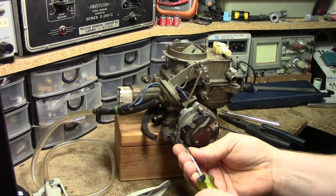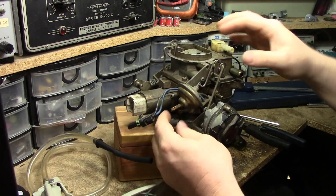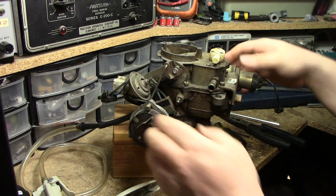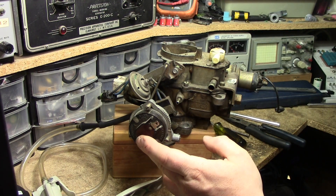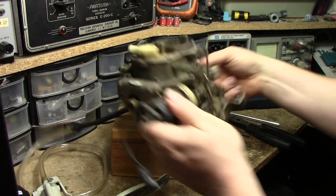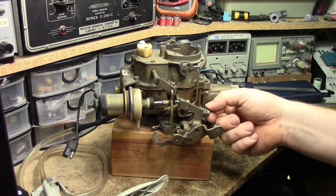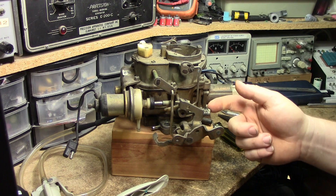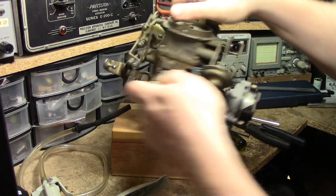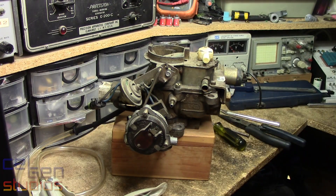And there we go. So at this point, when you start the vehicle up cold, it'll do the initial pull-off and will have it set to the correct enrichment and lean-out point. As this begins to warm up, it immediately begins opening the plate until eventually it just completely unloads on this side. There is another adjustment for this linkage, and obviously an adjustment for the fast idle cam as well — those are not part of this overview. All I wanted to do was tell you exactly how you set the electric choke. I hope this helps.